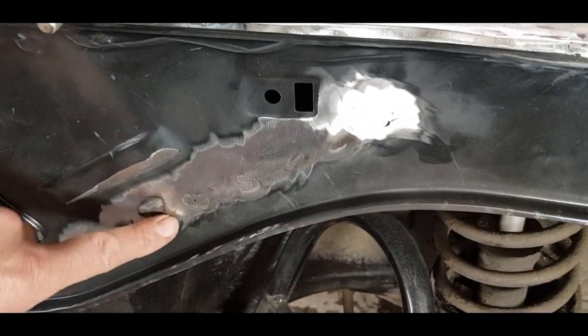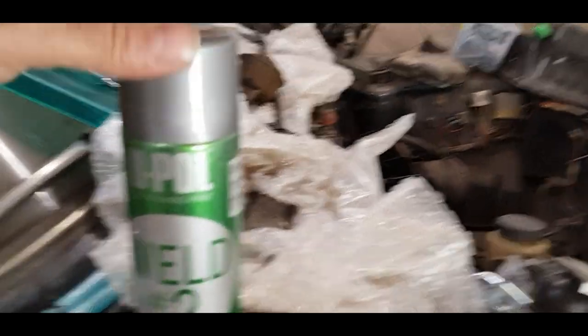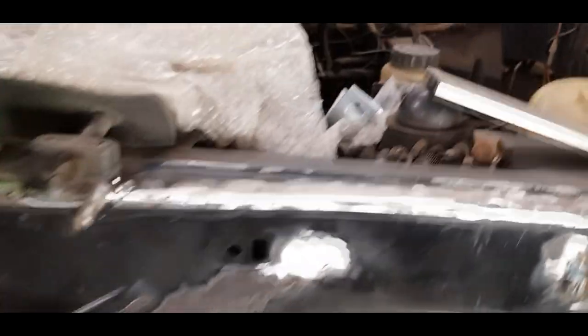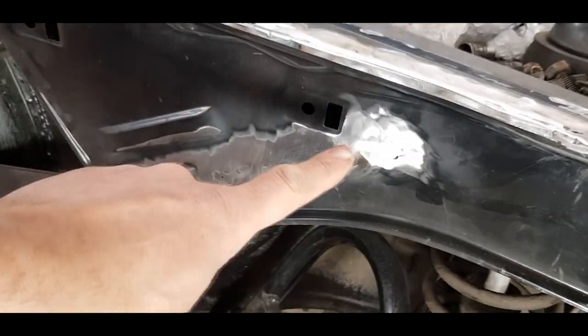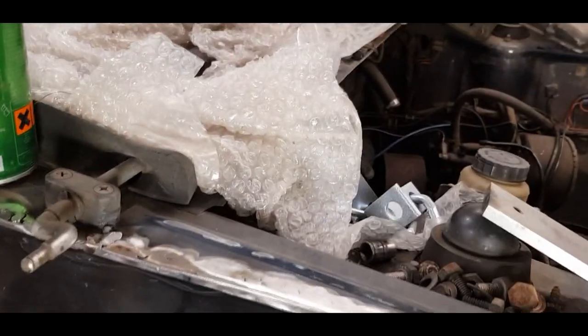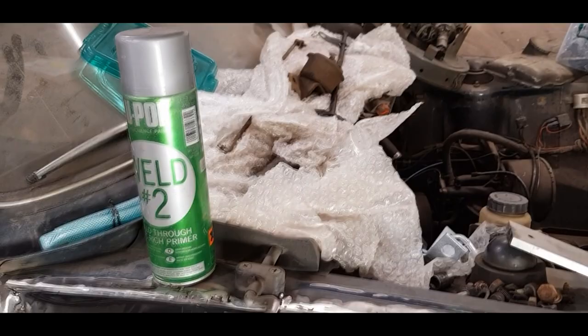There was a metal wing support that's spot welded on there. Now I'll tell you what I did and I'm not that happy with — because it was shiny metal when I was welding through, I used a weld-through primer, part of a range I quite like. But what happened was all this shiny metal was exposed when I plug welded the holes, and I know this stuff can be quite difficult to weld onto as you've got to burn through it. I did that, left it, and when it started cooling it literally just popped off. I don't think I'm going to use that stuff again for actual weld-through.